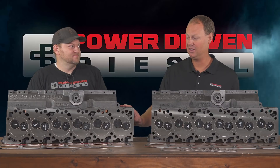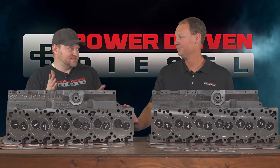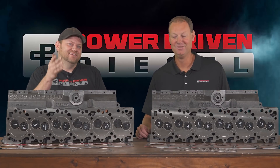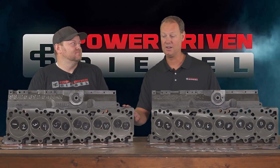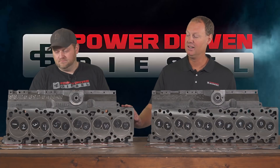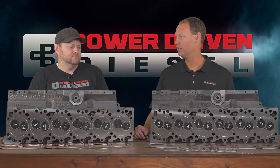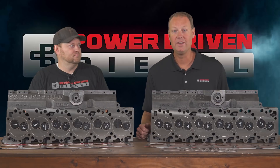I've never had an o-ring vehicle myself — I just know fire rings are better, so I went straight for the big power option. But we've done a lot of o-ring builds here in the shop and there's nothing wrong with them. My '98 12-valve has been right at 700 horsepower to this day with an o-ring — it's even my daily driver, towed to Denver with it. So the o-ring is not the wrong option. Most likely it's the right option unless you're making big power, at which point fire rings are where you need to be. Fixing an o-ring setup can be done at any shop anywhere; fire rings pretty much require a specialty shop.